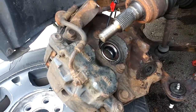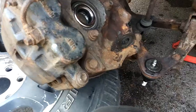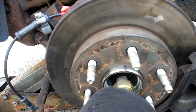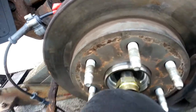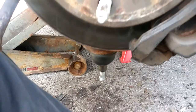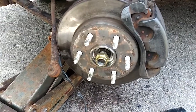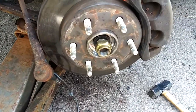It's heavy, so you're going to have to use both your hands. Obviously start from the bottom — get the bottom in, then lift up to get the top in. Gotta get your CV axle in. Ladies and gentlemen, boy was I wrong — you put the lower ball joint in first, then the CV axle, because if you put the CV axle in first it's going to bottom out on the lower control arm. So: lower ball joint first, CV axle, upper ball joint.